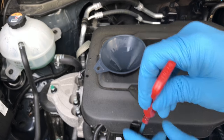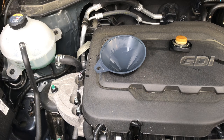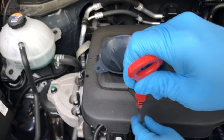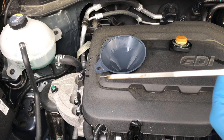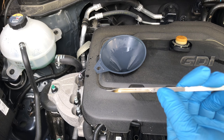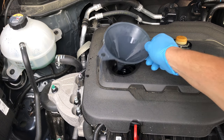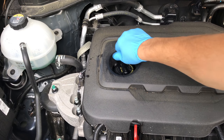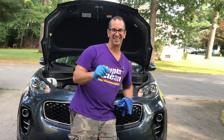I've been in auto repair for over 30 years, so you can apply this to just about anything. After adding more oil, wipe the dipstick again — make sure you're on a level surface when checking. We're just about at the full notch. This motor took about five and a half quarts. Put your dipstick back in, move the funnel, and put your oil cap back on — make sure it clicks.